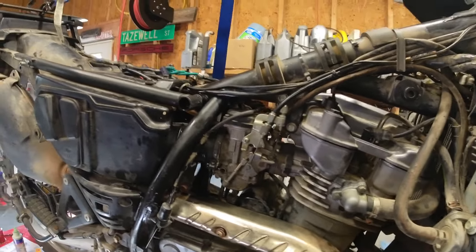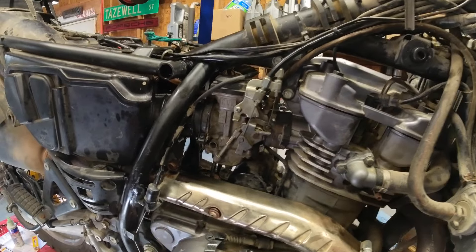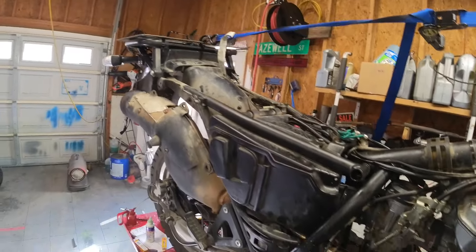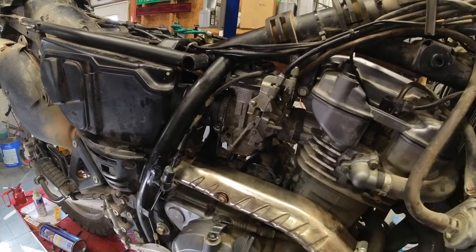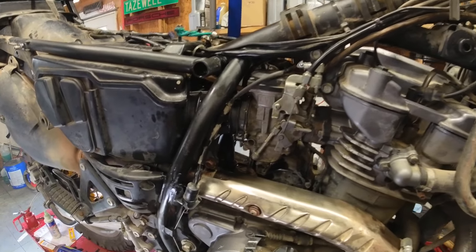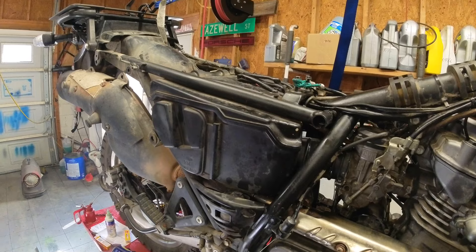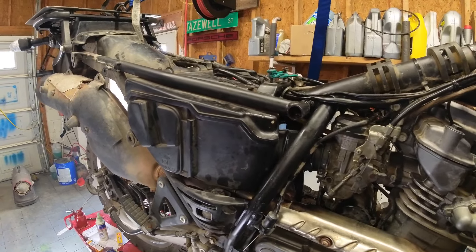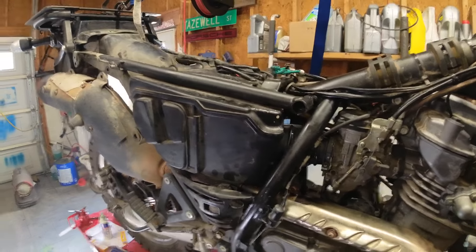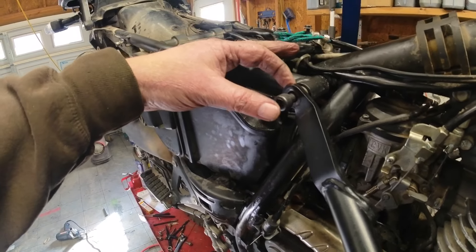While I was pulling the frame apart earlier, it pulled the boot off the front of the carb. What Eagle Mike suggests is to take a strap and run it across there so you can pull the frame back up into position, and while doing that get your boots back on. I made sure my boots are on and tight now. I'm gonna put the bolt through the top here — I also need to get the crash bars in the right position. Getting all that lined up.